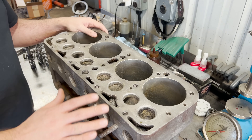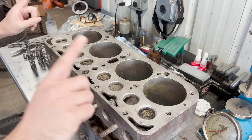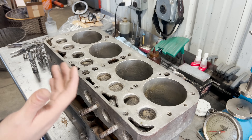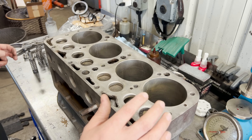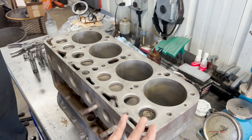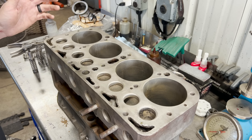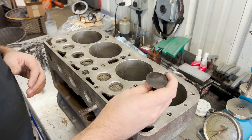This engine features a flat head design, meaning the valves are actually in the engine block. The cylinder head, as the name suggests, is flat with the combustion chamber in the head and no valves or valve train in the cylinder head. The valve seats are simply machined into the cast iron of the block, which was fairly common up until the move to unleaded fuels — meaning they're fairly soft and won't stand up to today's unleaded fuels.